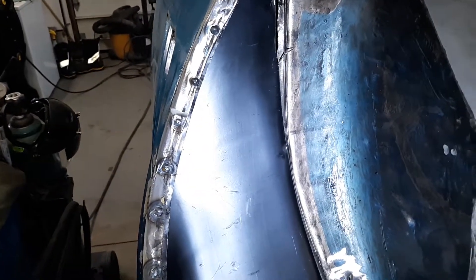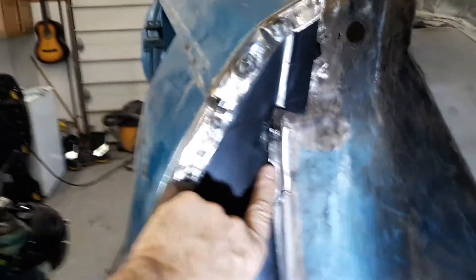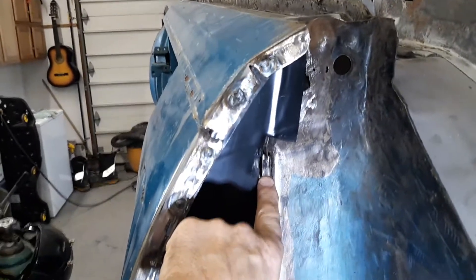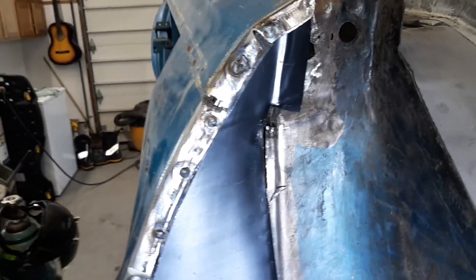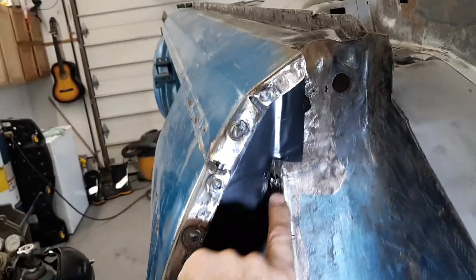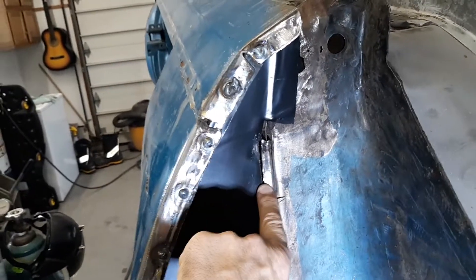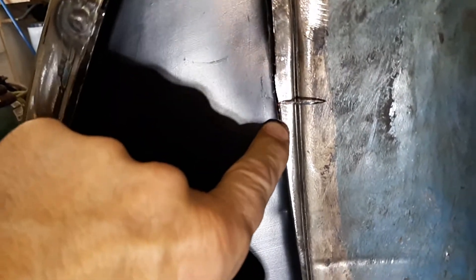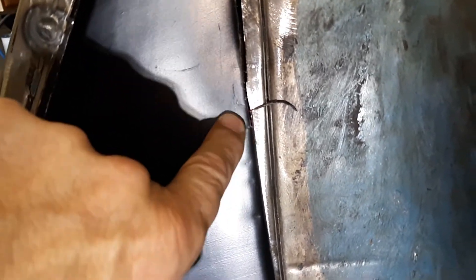So that's been done — it's spot welded back in, which is always fun with aftermarket sheet metal. Here, as you can see, I've started my seam cut. What I do is leave about an inch of original panel on and then I just lay these over. When this is done, you'll never know it wasn't factory. We've got good steel here, new steel here. This cut is to show you what a three-inch saw or disc will do versus a body saw.